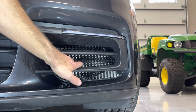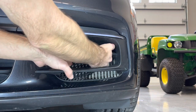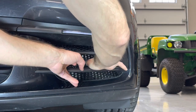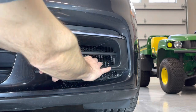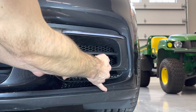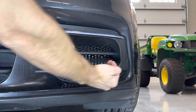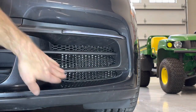Take the loop towards the center grille and pull it towards center. Grab the other maneuvering loop and pull the grille down. Pull on that outer loop forward until you hear the grille pop into place. At that point you have it far enough forward to the back of the slats. Now center the grille left to right and make sure the edges are hidden.